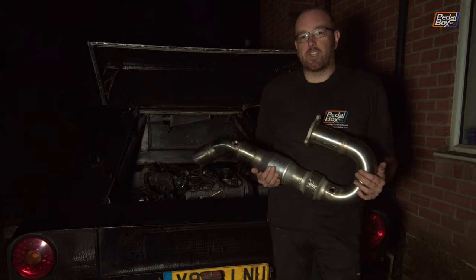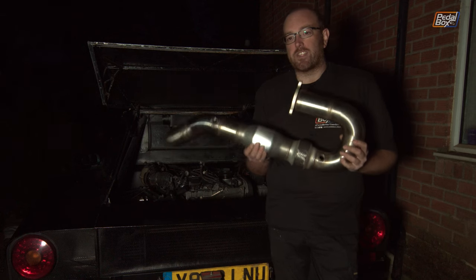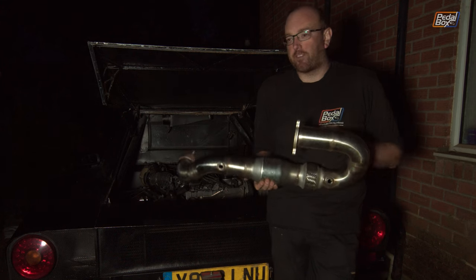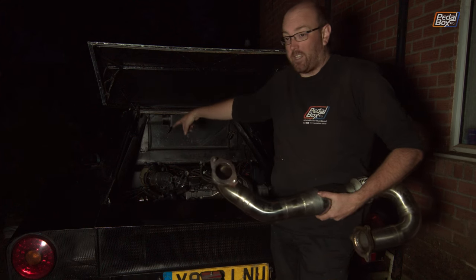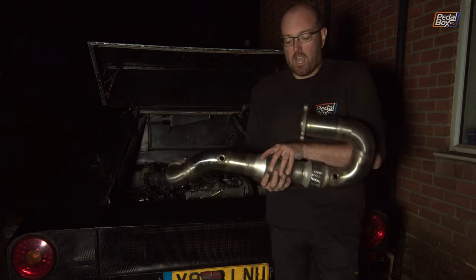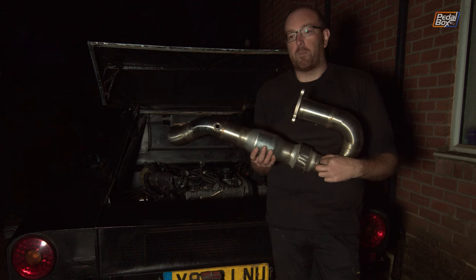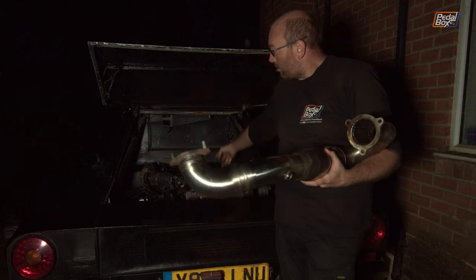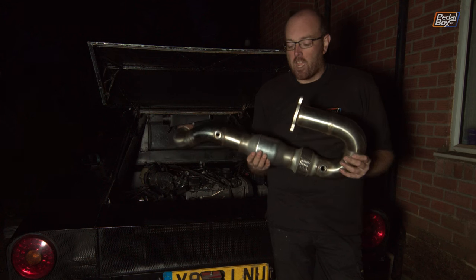The last thing we're going to do today, because it is now dark, is put the exhaust in. We got this back the other day — the O2 bungs are all welded up, so this is now finished. That means we have a complete breathing system from the very front of the air box on the top of the car all the way through the engine to the exhaust tips, except for not having the O2 sensors in yet. The wiring loom is all ready for them, so the sensors will be on order and go in at a later date.